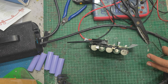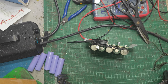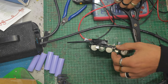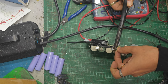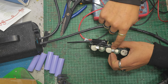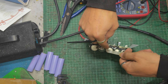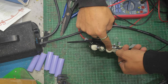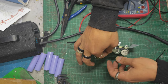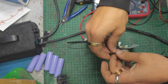I don't know if I want to solder them as I go, or wait until I've got more hooked up to it, to be honest. I'm not sure. I'll do the next one while I'm here, anyway. Okay. This one. Got to slice off. I could make these look really pretty, but it's a battery for me and I don't care. So, we'll want a piece of nickel that will span the two. Go from there to about there. So about yay big. Just like that. Trim the corners a little bit. That'll sit nicely.